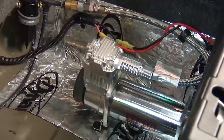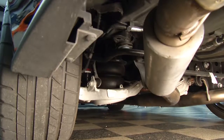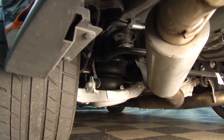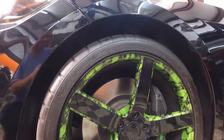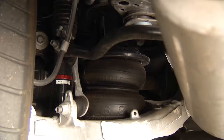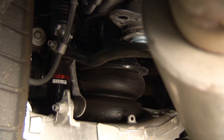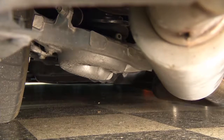There's a valving system that puts the air to each corner for the air ride, and a compressor that fills the tank. It goes through the car and has self-leveling sensors, so when you start the car it'll actually come up or go down all by itself. You have air stored in the tank and empty bags — hit a switch, activate the solenoids, and transfer the air from the tank to whichever air bag you push the button for.